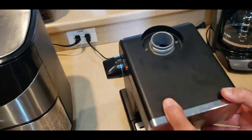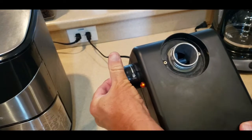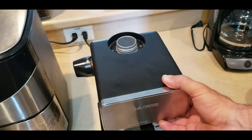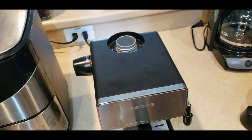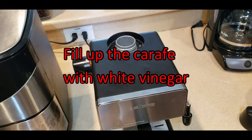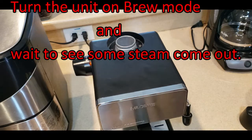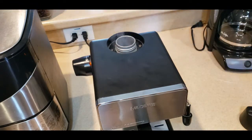So what I did the next day, before taking it to the range or throwing it out, I left just a little bit of fluid in there so I could see it steaming up, turned the unit on, had a cup of distilled white vinegar ready to go sitting in the carafe, and once I saw that steam starting to come out, I carefully poured that white vinegar into the maker.